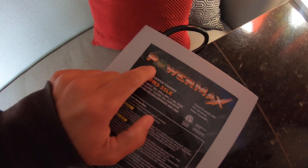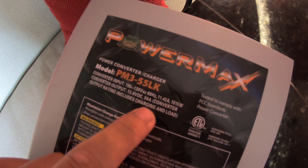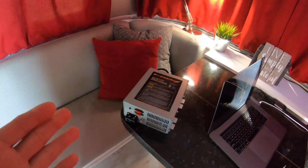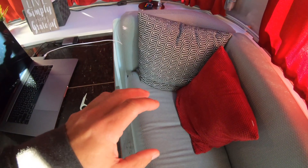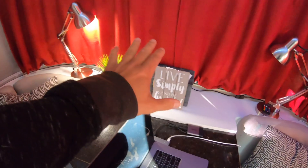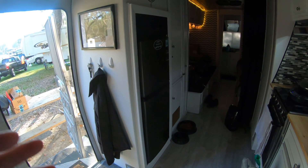This is the one I grabbed - it's called the PowerMax PM355LK, a 55-amp converter. That's going to draw quite a bit of power, and in theory it's even better than the one I have. The one in here is almost 42 years old - it's an old Progressive Dynamics 40-amp converter - so this 55-amp unit should get my battery topped off much faster.